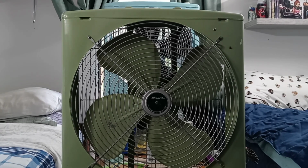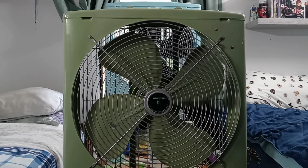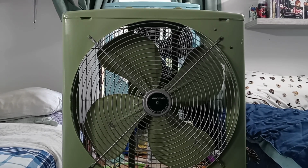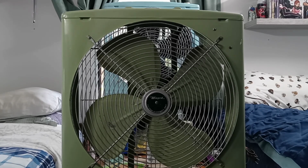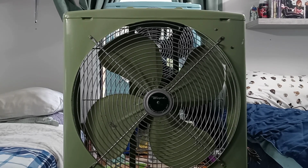This fan has led a long hard life. This thing was really rough when I got it. The motor to this was already going out. It looked like the thing probably had never been oiled or lubricated throughout its entire lifetime. It was noisy. It grinded. Did not run at normal speeds, and the blades were out of balance, and I am highly convinced that is what led to the failure of the original motor to this fan.